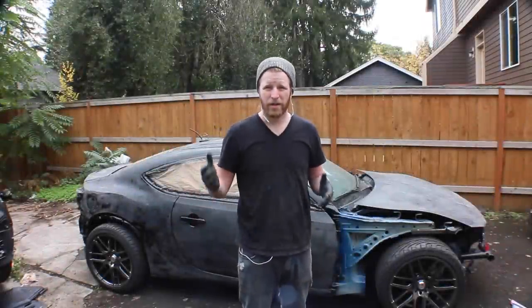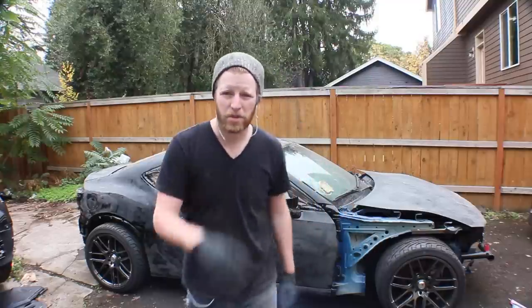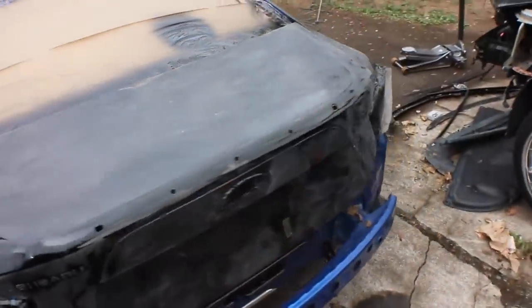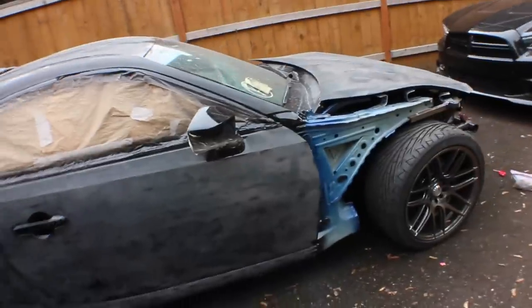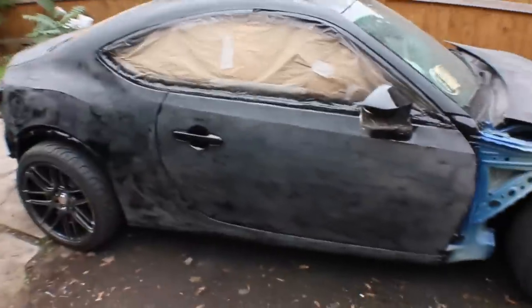Alright, it's been an hour. It's about 12 o'clock in the afternoon. We've got about one hour until the premium time for painting. We did 220 on the rough spots and then came back around with 320 on the DA, so that's scuffed up the paint pretty well. The next thing I'm going to do is come over it with 500 and wet sand it with 500 just to get it nice and clean. And everywhere where I busted through the edges I need to spray primer. So first up I'm going to clean the hood, spray primer on there, and then come over the rest of the car with 500 by hand wet sanding it.